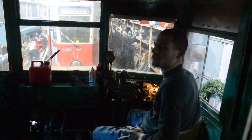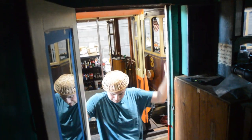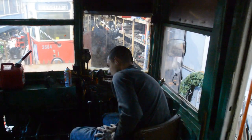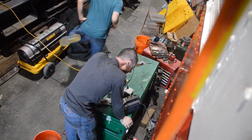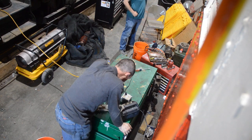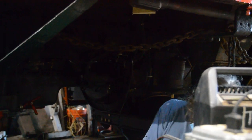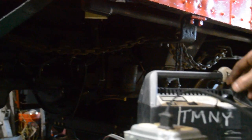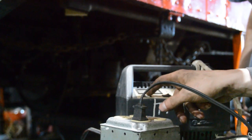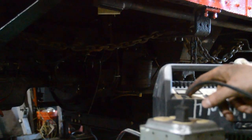Go under the car — I need you to listen for the fuel pump. I want to make sure that's operating. Go back toward the tank and tell me if you hear a motor running. Right now we've got no registry on this gauge at all. Voltage is at nine. Now we got it — a little tiny bit more, getting up to ten. You got ten. As you can hear, the car is now running.